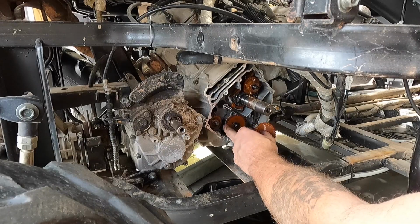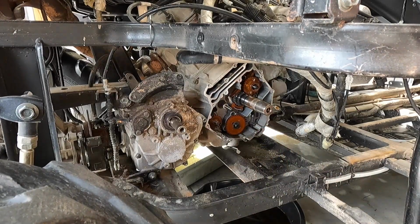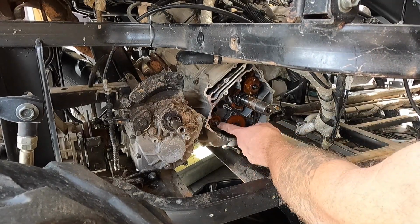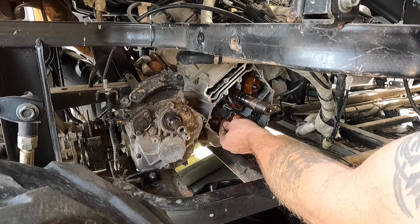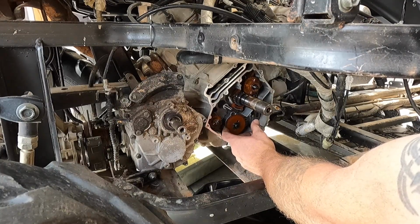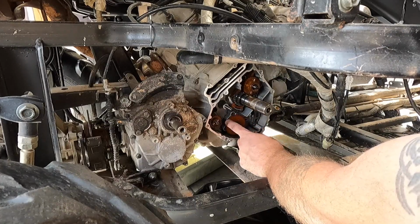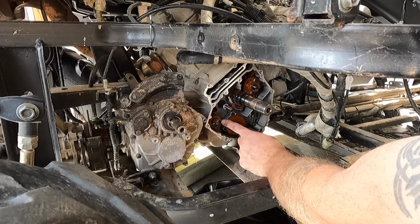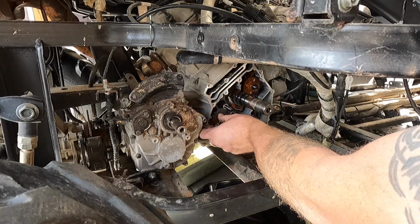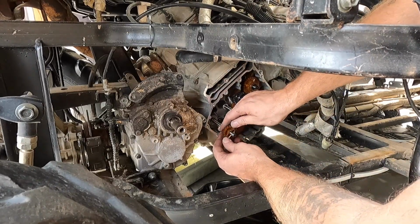But boy, I tell you what, that oil pump gear, woo-wee, it is awful. That feels awfully worn. But yeah, he just replaced that, thought it went out, and he actually lost the pin that went to the water pump. But that oil pump gear, man, that is definitely pointy. So I think we're going to have to order up an oil pump gear for sure. And then I need to tap back in this little guy here. Should come off right there.